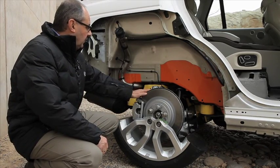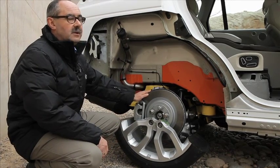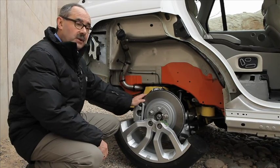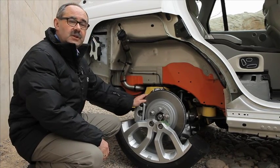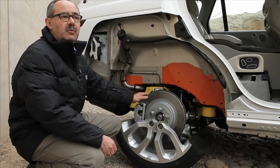The upper and lower control arms are made out of aluminium in this case. On the rear, we were able to overcome the potential issues with off-road damage by adding some sacrificial ribs to the bottom of the control arm, so they can be abraded away and it protects the structural integrity of the part.